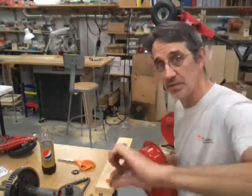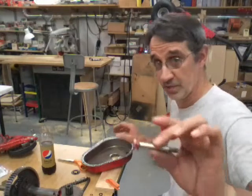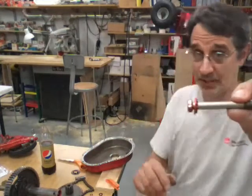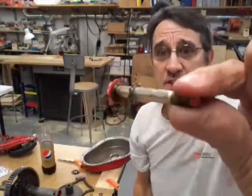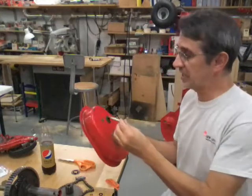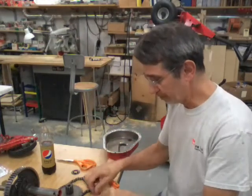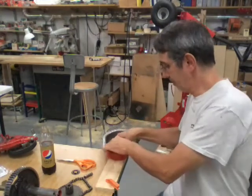The three-quarter-inch hole doesn't go all the way through; it just has to be deep enough for the head of the bolt to sit into. They are three and three-quarter inches apart. This is the bolt that holds the sprocket and gear assembly in the differential. It has a standard washer on it and a standard star lock washer in that order, then it goes through the case. You can set it in your little handy-dandy holder. Next, put the rubber o-ring over the bolt.